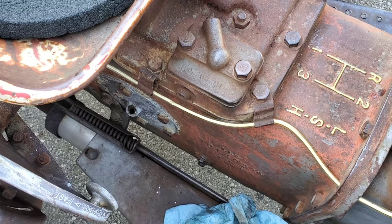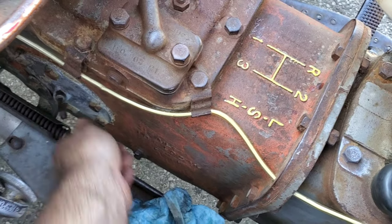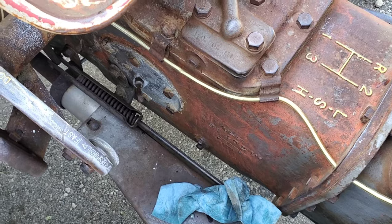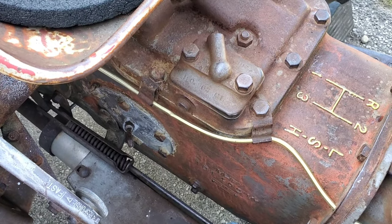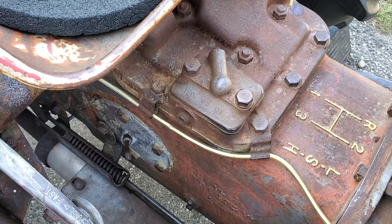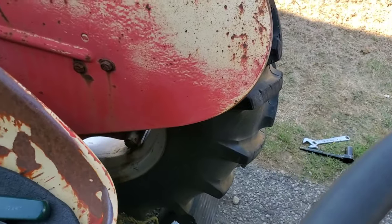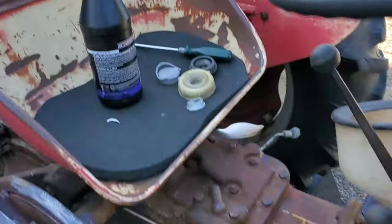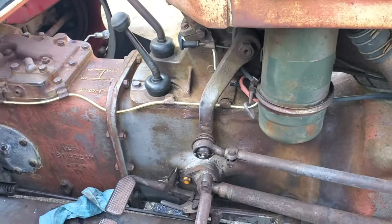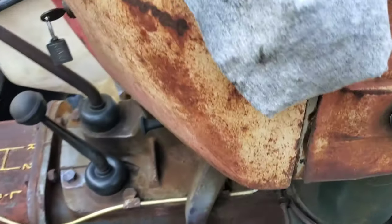A little bit of foaming. We'll see if that settles down. Could be a little moisture in there. Not happy about the moisture, but what are you gonna do? We'll throw one more liter in there for good measure, maybe two more, and then that'll be it. So that's the oil change. Didn't take long, 40 minutes, and we're going to run this oil and check it for moisture later.